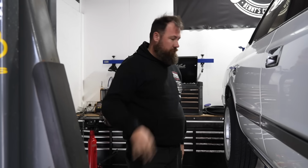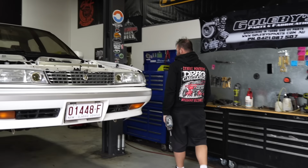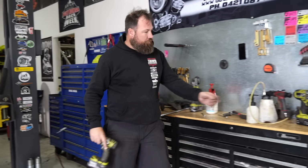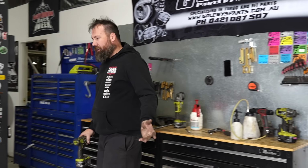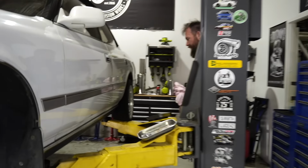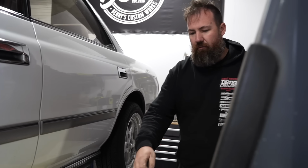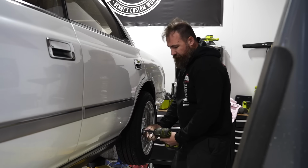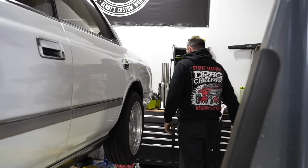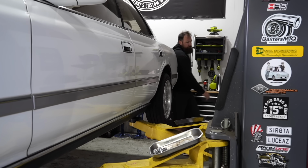Is there a scenario you can think of where you would want to have that running into a bottle? Oh, I mean, what I'm doing is not the right thing to do. It's more just, A, it's my car, B, I can visually see if there's air, because a lot of these brake suckers, they're pulling air from around the nipple and also potentially a vac leak here. So the visual here always looks like it's got air in it, but it's not a true visual representation of what's actually happening. We've just bled half a litre of fluid through the front circuit, so there should be no reason that there'd be any air in it, especially because we haven't replaced the lines or the master cylinder. It's purely just replacing the calipers, so it's only really the volume of air in the caliper and the junction from joining the line into the caliper that's actually going to induce air into it.